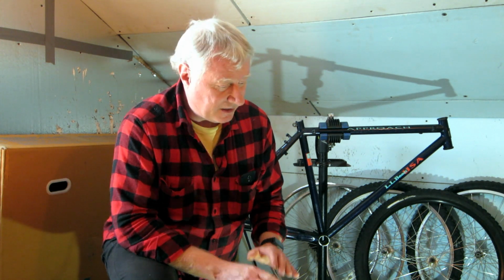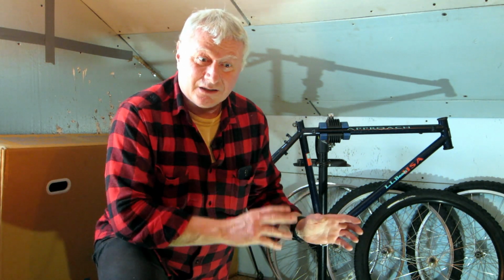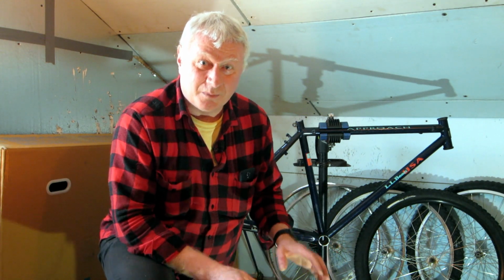I was impatient. Had I gotten the major portion of the bottom bracket out first, then I could have probably done something from inside the bracket shell that would not have destroyed the threads. So I first tried chasing them out with an old drive side metal bottom bracket cup, and that worked about as poorly as you might think.